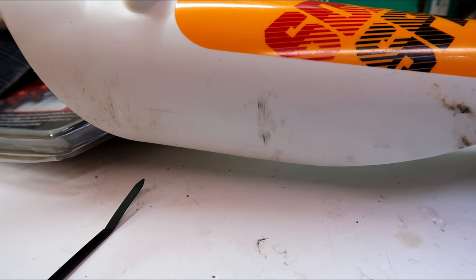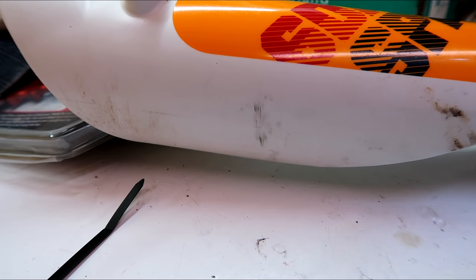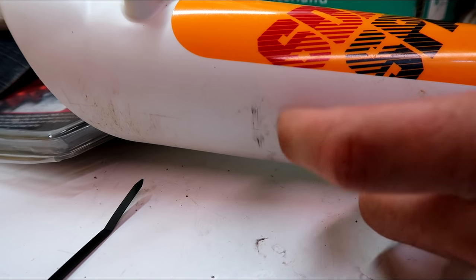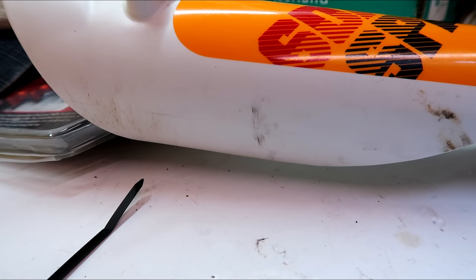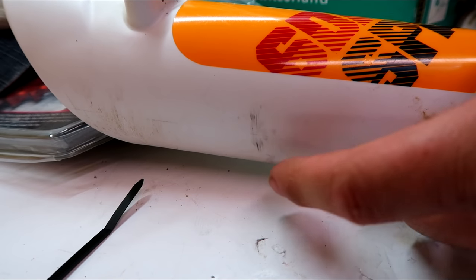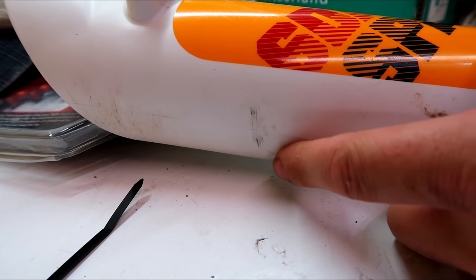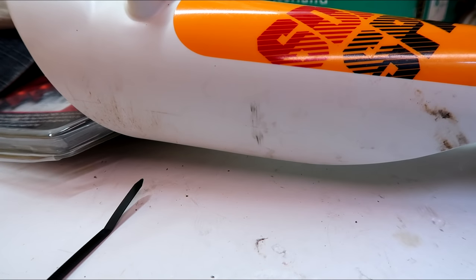So I've put on the guard for trimming and held it on there. I've just spun the wheel and it's left a little mark of where the tyre is going to touch the guard. So I'm going to use that as my template for what I have to trim — probably just trim a small section like that with the Dremel, just so it doesn't catch.